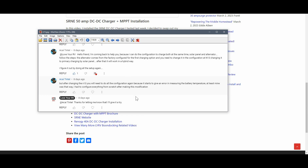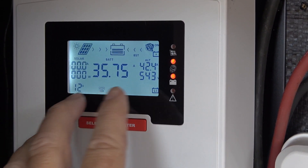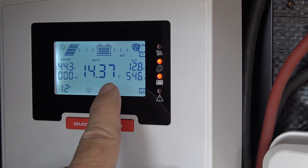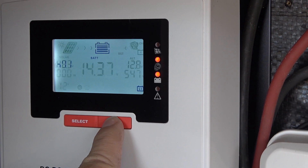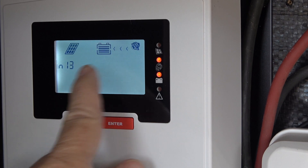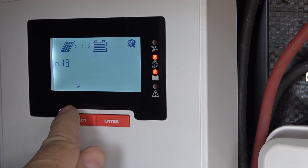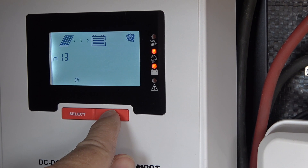So I thought I'd give it a test — let's go out and have a look at that. Here's what I have to do. In the stock arrangement the solar panel is hooked up and so is the alternator, but only the alternator is charging. I have to go into the settings, find the N numbers, go down to N13 where it shows generator to battery, hit enter and it flashes, then hit select and it moves over to the solar panel.